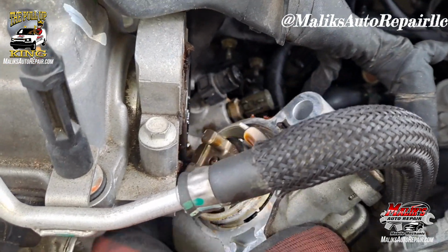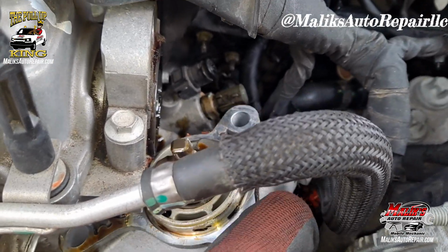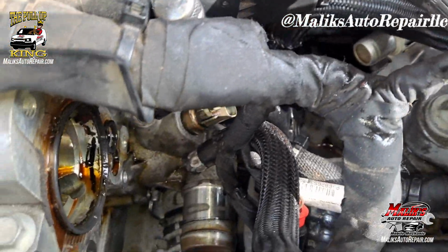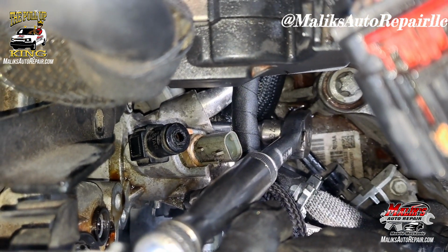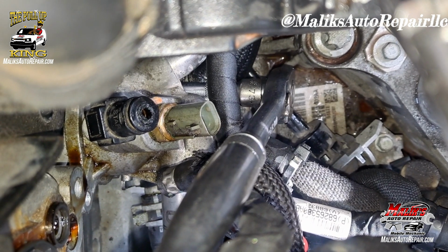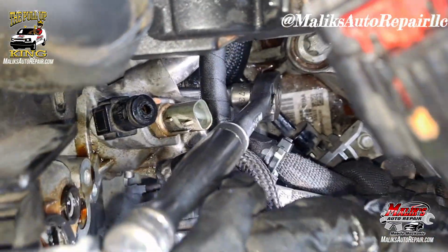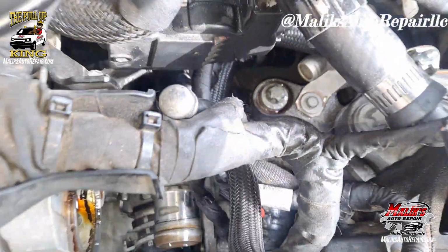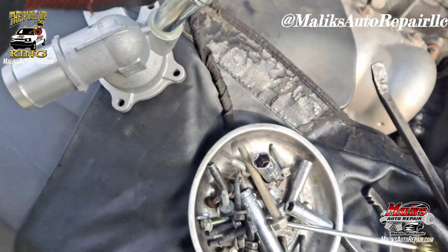Use my pry bar to pry this thing out because it was in there pretty good. Let me show you the hardest part here. Is that bottom bolt, bottom right. Got an extension on there with a 10 mil, and it reached it. It was hard. That's the hardest part, man. But I broke it loose, and now I'm undoing it. That's where it is. That one right there.